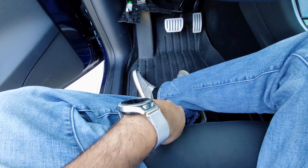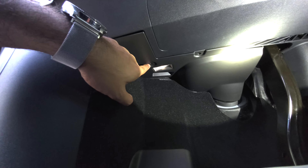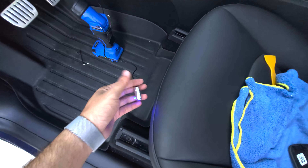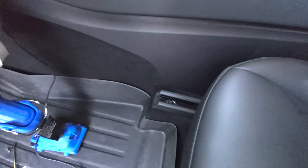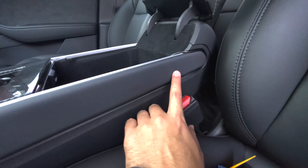Not too hard. So before I get too far into this, I wanted to show you guys where you need to remove the screws. You've got the rivet here, the actual hex screw here, and one more rivet right here — a total of three. Once the rivets are removed, you can put your hand down here and literally just pop the panel down. Just be wary of the two cable connectors here. At this point, turn on the connector so the light is actually lit on the LED — this is going to make it easier to route. Once you've got that panel down, the easiest way to route is going around this center console side cowl piece and it routes right underneath. It actually wedges out a little bit, so if you use the crevice tool here, you'll see that you can push the wire all the way in for a nice clean look.